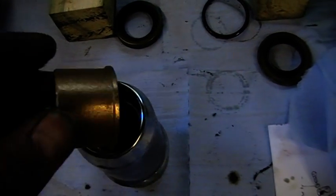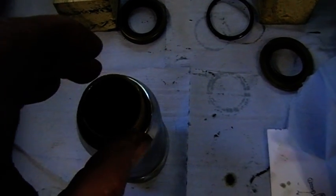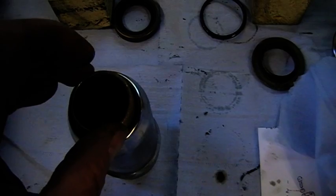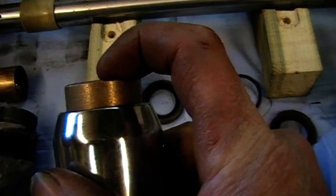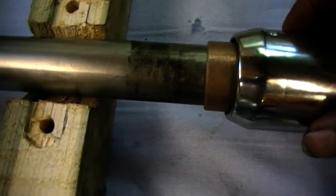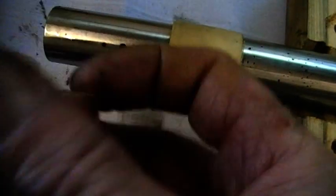So obviously I'll pretend I've put this O-ring in first. When you put this bush in, so you've got the top edge here, so that goes down, you've got to put it in and you have to wiggle it gently with a circular motion. Bit of oil on it. Make sure you do that. Don't try and force it down, hammer it down or push it down. You'll just guillotine that seal again, that deadly seal. Once that's on, that'll be kept more or less in place by that O-ring. And then that goes on there, like that. So that's your top bearing surface.